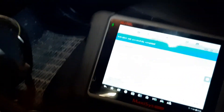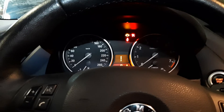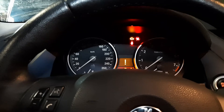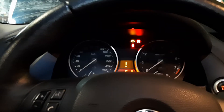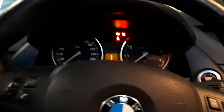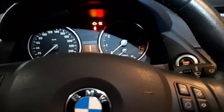If you actually don't have a scan tool, it's harder because you need the right conditions. Bleed manually the best you can, and if you have snow that's actually very helpful — drive it, floor it, and slam the brakes so the ABS kicks in. It'll push out quite a bit of air. It's time-consuming because you have to get the ABS pump to kick in a few times, then jack it up, do the bleed, and maybe repeat two or three more times. In my case with the scan tool, after a manual bleed that didn't work, going around twice this way solved it — brakes were like new. I hope this helps.